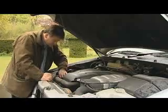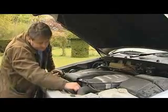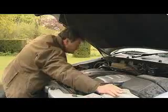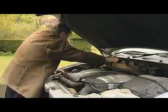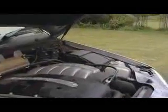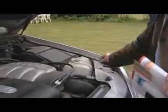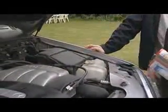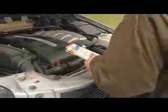With the engine still running, it's time to go under the bonnet. Check carefully for any signs of oil or water leaks and look at the driveway where the car's normally parked for evidence of old oil stains. But if the engine bay looks too clean, be a little suspicious. They may have cleaned it up to hide some oil or water leaks, or it could indicate the car's been subject to a major front-end repair.